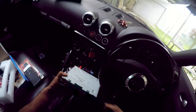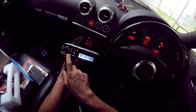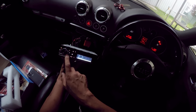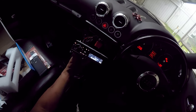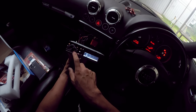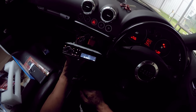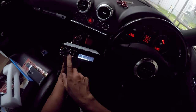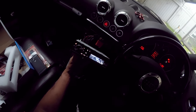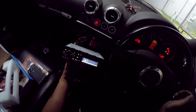We'll give that a go and see if it does the popping thing — hopefully not. That's way better. Ignition off — no pop. I hooked it up to Bluetooth already, it should connect to my phone. Awesome, working without the pops. You can definitely see there's no more pop when turning the stereo on and off or when turning the car on and off. So those ground loop isolators really work, which is great.